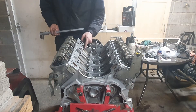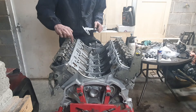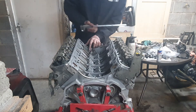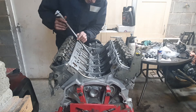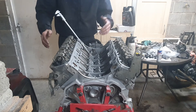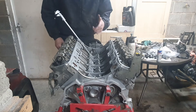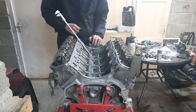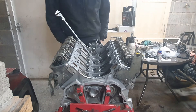The pushrods are pushing the tappets really quite far into the buckets, so I'm pretty sure we need some shims under these posts to raise the rockers up. From a video I need to confirm it, but 20 to 50 thou below its resting position is where it should sit. What I'm going to do is use this vernier caliper to push onto the top of the bucket, measure that, then release the rockers and do the same measurement again so I know how far in they're pushed. I need to make sure the engine is turned to a position where these are not being pushed at all, measure all of those, see what I need to get them between 20 and 50 thou, then do something clever with the rocker ratio of 1.6.